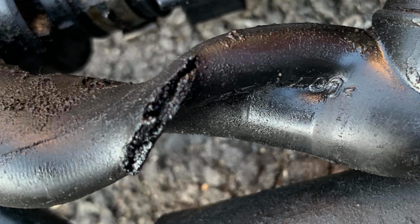Any one of those pipes could have been fitted wrong. The silicone could have, if you imagine this is a silicone pipe, not a can of Coke, where you mount it on, it could be sat slightly wonky. Instead of being straight, it might be sat slightly wonky. It might be letting air in. One of your old Jubilee clips might be split.